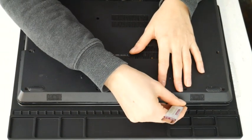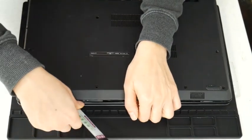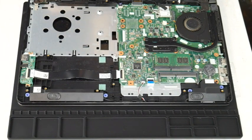So I'm going to go inside my computer. You will need a disassembly video because each model of computer is different, but I'm going to go inside and clean off the damage because even dried liquid can cause connections that are not supposed to be there, so when you turn your computer on, it fries.